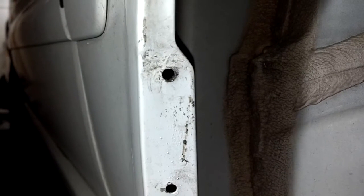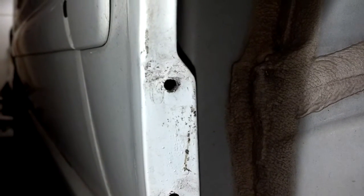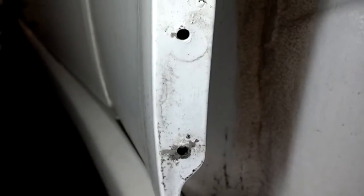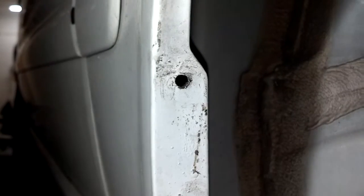If the holes in your fender are not flat, what I do, I put the sledgehammer behind it, the head of it, and then I tap it flat with the regular hammer so that those holes are nice and flat and smooth before I rivet this splash guard in it. Okay, I got 6 rivets there and 5 rivets on this side. So this side took 11. I got my bolt there, my bolt there, my bolt there. That mud flap is installed nice and neat, and now the bumpers are pulled up tight to the car too. So done for the day. Put this wheel on and move this car out of my sister's way.